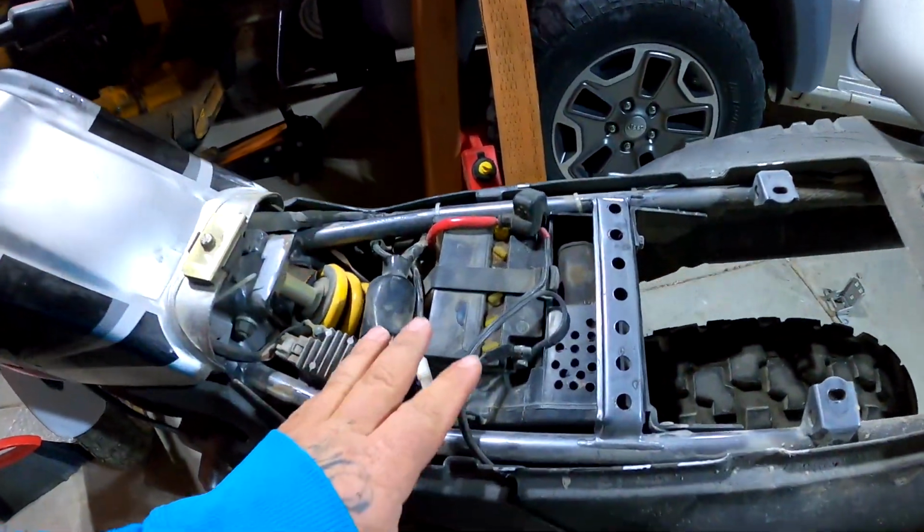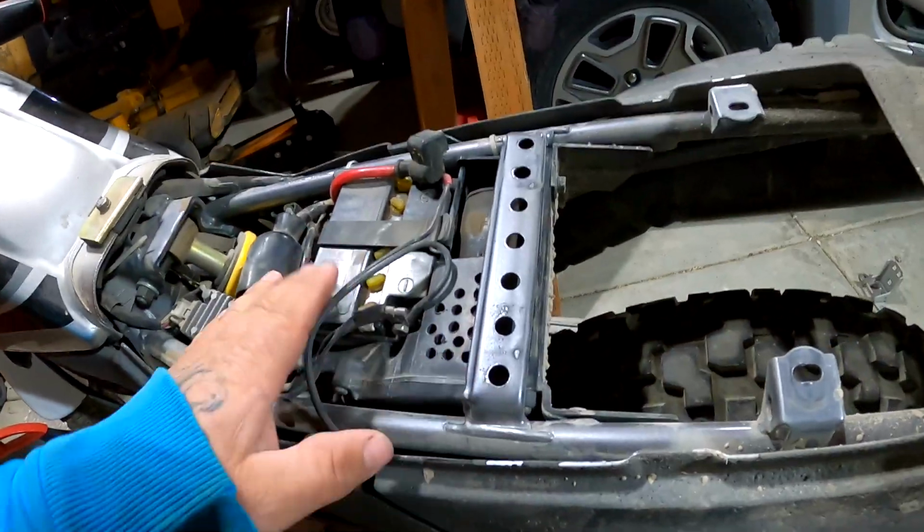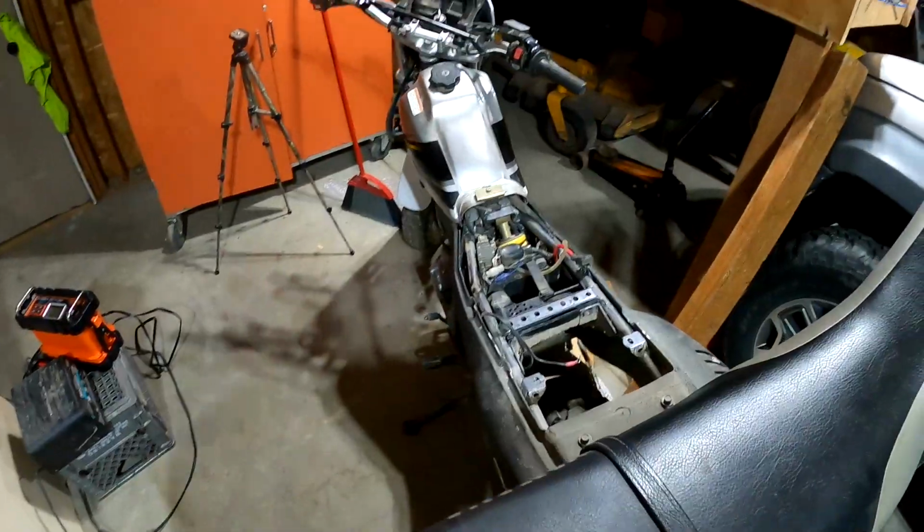If the charger charges it and it actually works, then it was the charger. If it doesn't and it's the battery, we're gonna pull the battery and we're gonna top it off with some distilled water. So I've heard that's a good maintenance tip where some people have this similar issue. We're gonna test that theory out for you, so stay tuned.